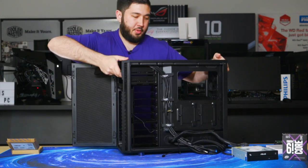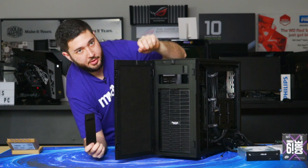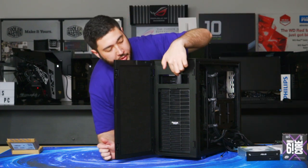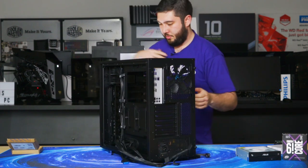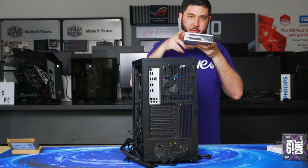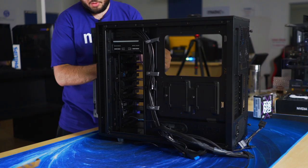So at the front, there's just a little clicker, you just pull it towards you and it lifts away. Keep this inside your motherboard box. So that slot is where the DVD drive goes. Just looking at the slot, just put the rear end into the case. And you're just trying to line it up so it's flush.